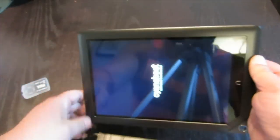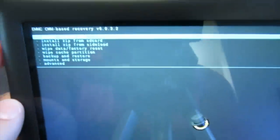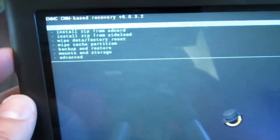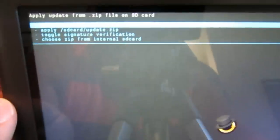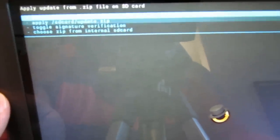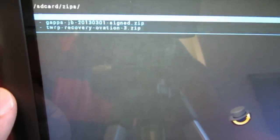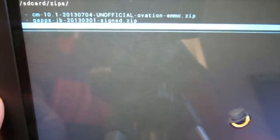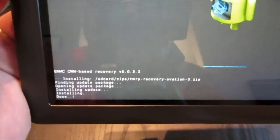Power this sucker back up. You'll see it's got a CyanogenMod boot screen, and it's going to boot up into ClockworkMod. Like all ClockworkMod recoveries, you use the volume keys to go up and down. The nook button is Enter and the power button is Back. We're going to do 'install zip from SD card', choose zip from SD card, from a directory I called 'zips', and flash TWRP recovery. Verify and install — done.